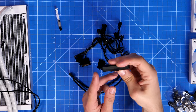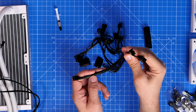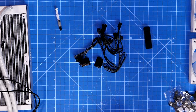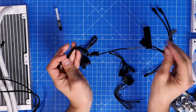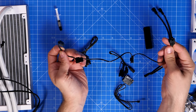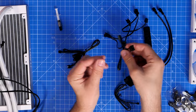You also have a mass of cables and a little control box. You can plug the fans' RGB lighting into the control box and control it by pressing buttons to cycle through color schemes. There's a Y-splitter cable — two connections at one end, single at the other — to connect both fans' power to one cable and plug that into a system fan header on your motherboard. There's also a daisy chain cable for RGB lighting.